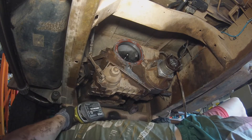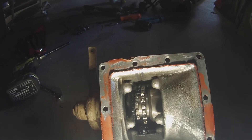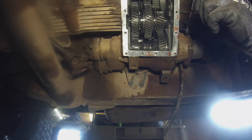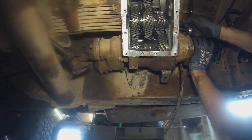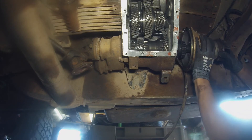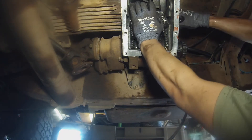Now there's nothing to stop us removing the bottom cover. Here you can see the lower sprocket driven by the chain and the dog clutch that's pulled in and out by that lever. At this point I've gone on the wrong track — you should remove the intermediate cluster before removing the speedo housing; it's a lot easier that way. It is possible to remove the differential without removing the intermediate cluster, but only if the bearing and the high range output gear are not stuck to the differential carrier.